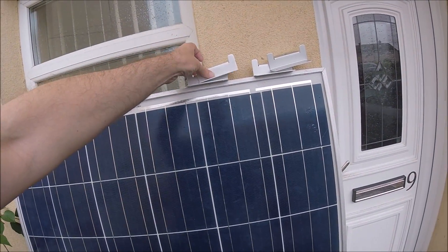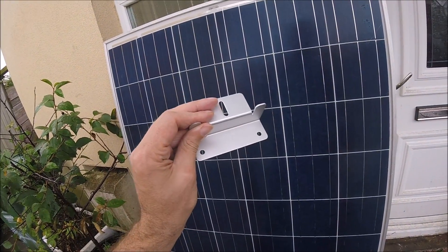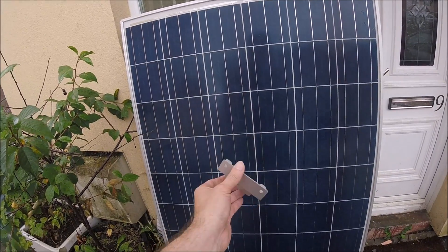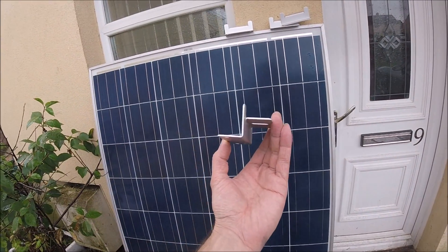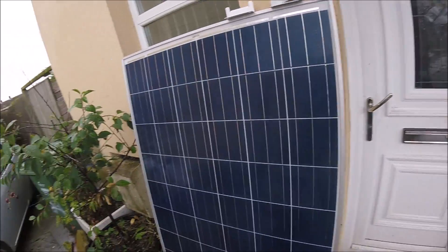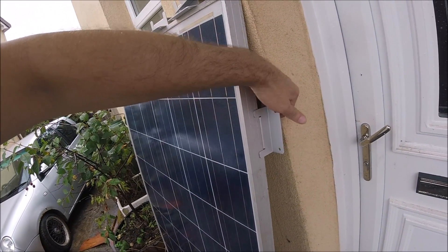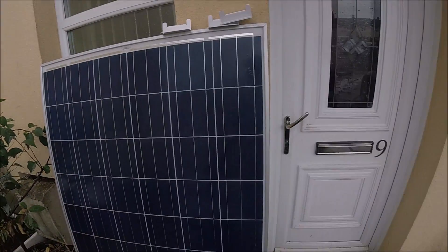These are the Z brackets that I've always used — I've never had any problems or issues with them. These are a permanent bolt fixture rather than the sticking-down approach of some other solar mounting systems. I've never really liked the idea of just sticking it onto the roof; I'd rather have a mechanical bolt going all the way through just to be sure it's definitely not going anywhere. These brackets will be linked below in the description. Each bracket mounts onto the side of the panel with a bolt through the bottom, giving two mounting holes to fix it onto the roof.